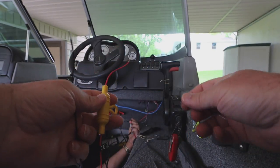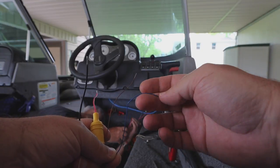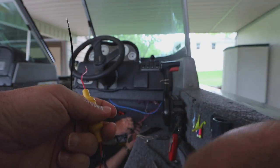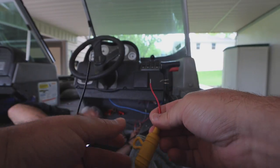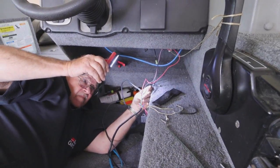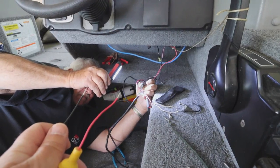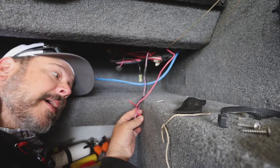So on the 93SV, we're not running LiveScope on this. The blue wire would be for your LiveScope or a brain box for communication purposes. The brown wire is just an old wire — they never quit making it this way — so the brown wire is trash. The red and black wire is all you're going to need if you're just going to be running the transducer. So up here you can see we've got all these wires sorted out. The only thing that you're going to want is the red wire and the black wire. So if you're into splicing, we already know how to do this, otherwise I'll bring you along with a couple of clips showing you how to connect these into the wires.